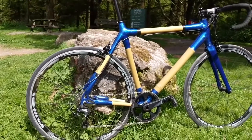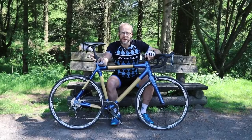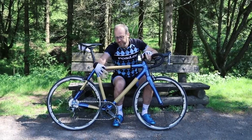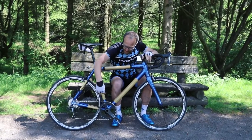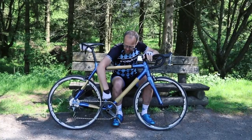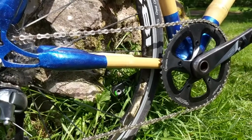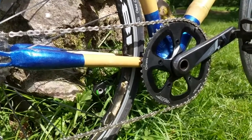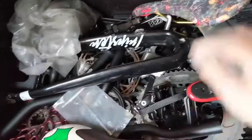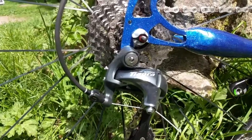So let me talk you around what I've got. I have got a single chainring at the front. The reason for that is because originally I built this bike up because I was going to go and do a race in it, and if I'm going to do a race I'm only going to need the one ring. Also, it's quite a complicated business to fit a front derailleur to a bamboo bike, because obviously you don't have a standard sized tube and it isn't round — you have to actually screw the derailleur in via a brazed fitting, and it has to be in the right place, which it won't necessarily be. So I've just gone with a single ring. I've got a SRAM Force 1x chainset and I've put a 52-tooth Praxis ring on that I had in the shed, giving me big gears — enough to still get up hills because I've got a 10-speed 11-32 cassette on the back, so a 52-32 which is all right for most climbing.